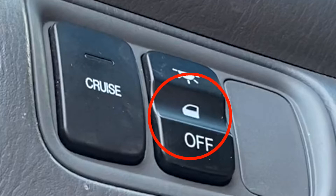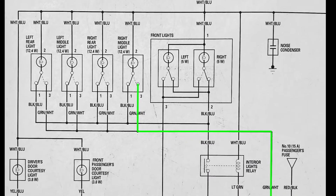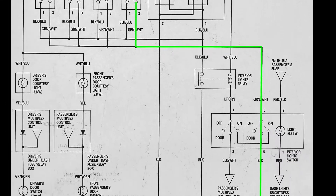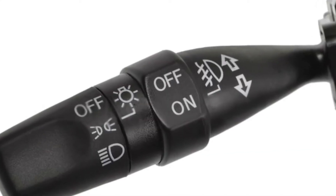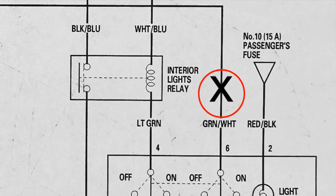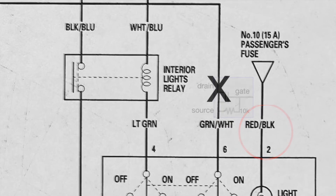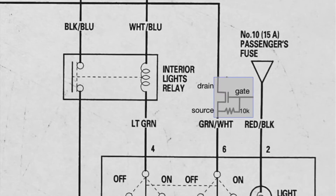What is accessible? Well, the switch is accessible. Here's that switch in the schematic, and you can see that it has the off, on, and door positions. But each of these really just determine whether or not the circuit grounds. So my thinking was to break this path here, shown in green, such that it is only connected when the headlights are on. The method for doing that is to break this line at pin 6 on the switch, and then control that switch with pin 2 right next to it, which is power — and that power is only on when the headlights are on.